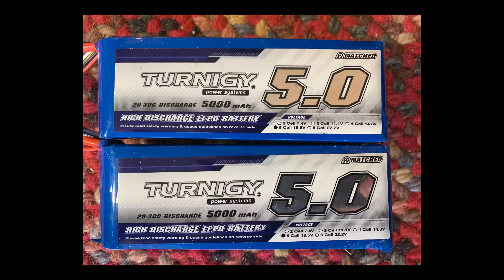Inside I'm using two LiPo battery packs. Each of these packs are five cells, and I put them in series — so fully charged, it charges up to about 42 volts. Now these are not very high capacity batteries, but they can put out a lot of current. So I'm not going to face an issue of not having enough current to drive the bike, but I am going to face the issue of not having a lot of capacity — I'm not going to be able to go very far before these batteries need to be recharged.